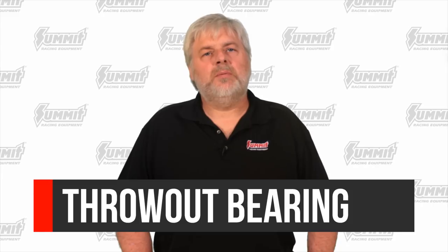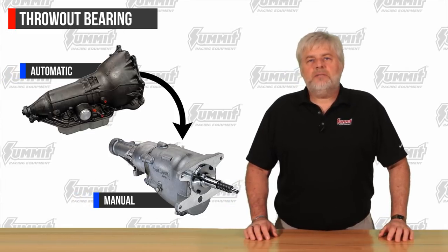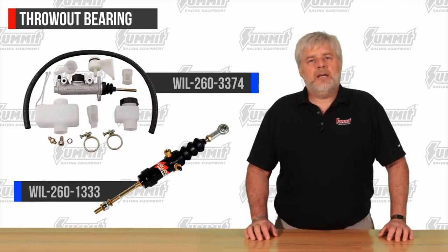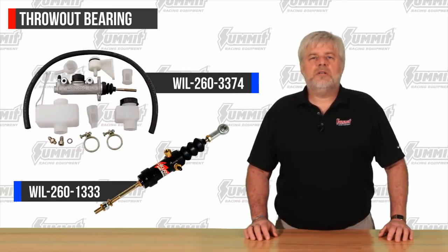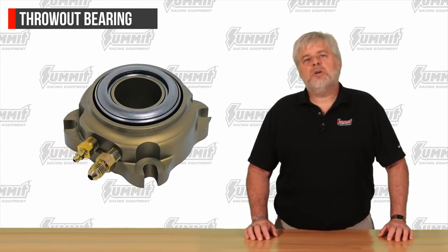It is important that this bearing be replaced when installing a new clutch assembly. Anytime you're doing a custom conversion on a vehicle from automatic to manual, you'll need to consider the method for clutch release. Historically, mechanical clutch linkage cables performed this duty. The newest designs incorporate hydraulic units which consist of a master and a slave cylinder. In swap applications, Wilwood makes the correct universal parts to complete these conversions. Also, many late model vehicles today are using a hydraulic release bearing as original equipment, and while just the bearing can be serviced while replacing the clutch, it's best to replace the whole hydraulic assembly due to the time and cost involved to access it again should it begin to leak.